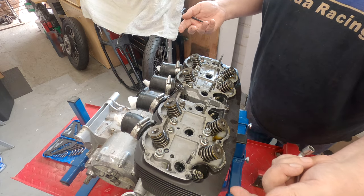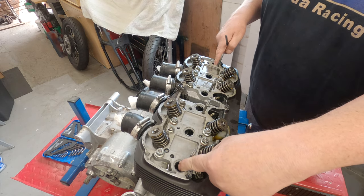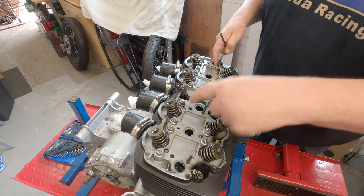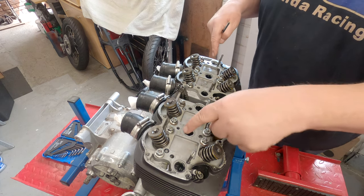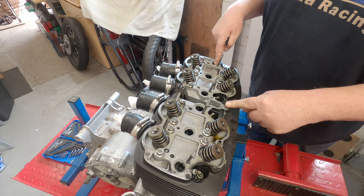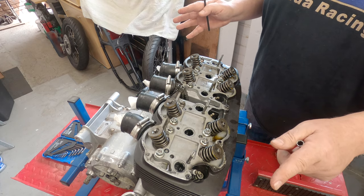Now, having looked in a workshop manual, it sort of implies to undo these first. Before I start putting things back though, I'll make sure I get a proper order. It doesn't really show a tightening sequence for these ones, but it does show a tightening sequence for those. So I'm going to loosen these off, take them out, or at least have them so that they're on the way out. Then I'm going to follow the actual tightening sequence in reverse to do the rest. I think I've already said that, but just to be careful.